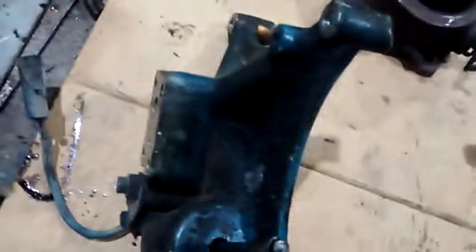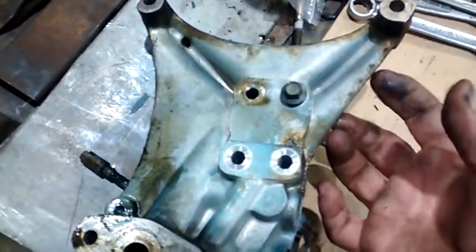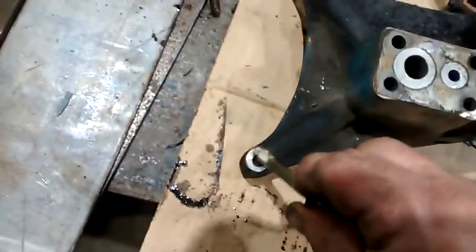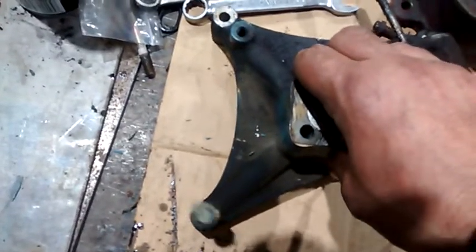And then this pedestal — the turbo bolts right on top of this pedestal. This pedestal has the valve which operates the wastegate. The new pedestal has no valve and no wastegate. But I just wanted to show you that there are four bolts that hold the turbo on that go through this way. The problem we were having is there was enough slack that the turbo could move one way or the other just a little bit, and when you try to line the bolts up into the engine, they wouldn't go because the turbo was being pressed up against the exhaust and cocking it one way or the other.